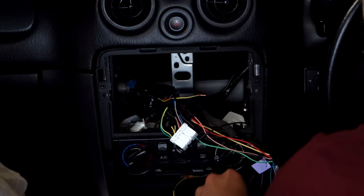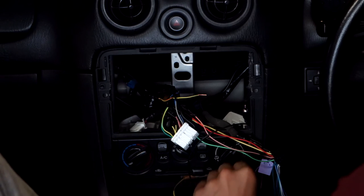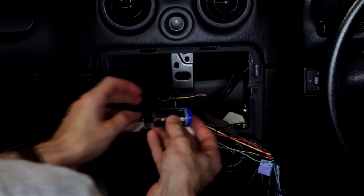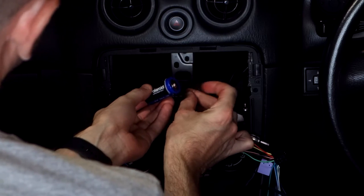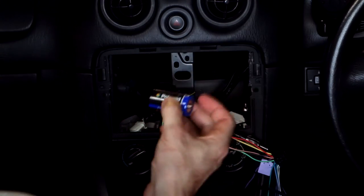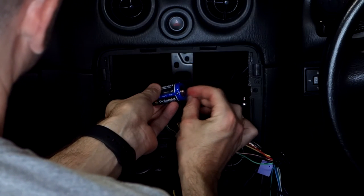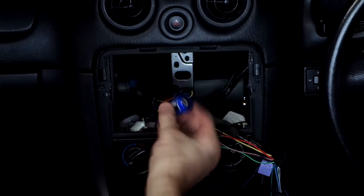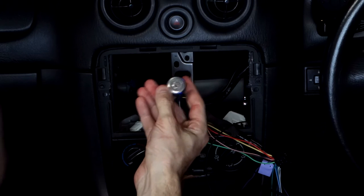It's reverse engineering. What you can do is get a AA or a C battery, and tap the terminals on the battery. If you don't know which speaker is left or right, you can figure it out by doing this. So that's the left. Tap it, so that's the left. But even more than that, if you don't know the polarity, you've got the positive nipple on the battery, which is your positive.